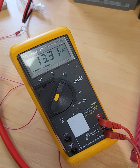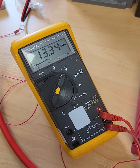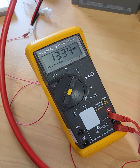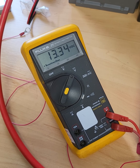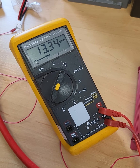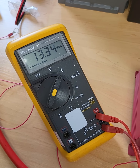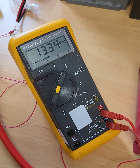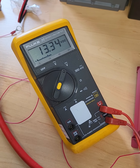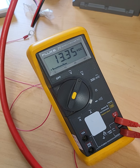It won't go any higher for multiple reasons. Primarily it doesn't need to, because it's just a float voltage — it's just to keep the start battery topped up. If it went too high, the battery-to-battery charger wouldn't know when your alternator has turned on versus the unit just feeding back to the start. So we've decided to compromise at 13.4V, which would be absolutely fine.